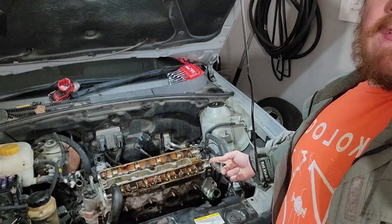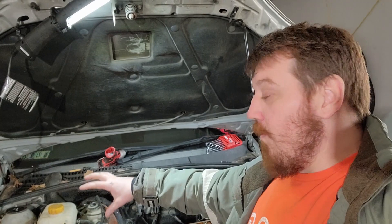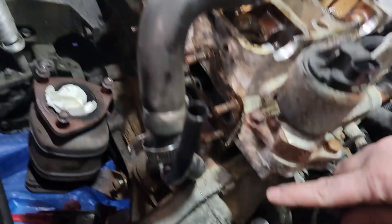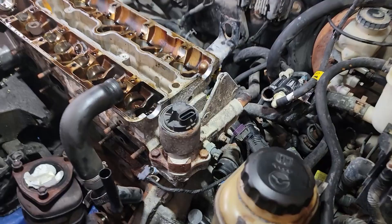Before we pull the head off the engine, literally all we have left on the head is the actual bolt right now. Everything else is done. I do need to take the inlet hose off here — that's only two E10 E-Torx, not a big deal. And then on this side of the engine we'll see the EGR valve here, and there's an actual plate that this all sandwiches on — it's also like a union and a bracket for our rear coolant return hose. This whole assembly has to come off. Pull this little clip off, and this must be a coolant temp sensor right here — pull that out. This is a 12 millimeter bracket bolt, and then we have three E14 E-Torx bolts. Let's pull this off now.